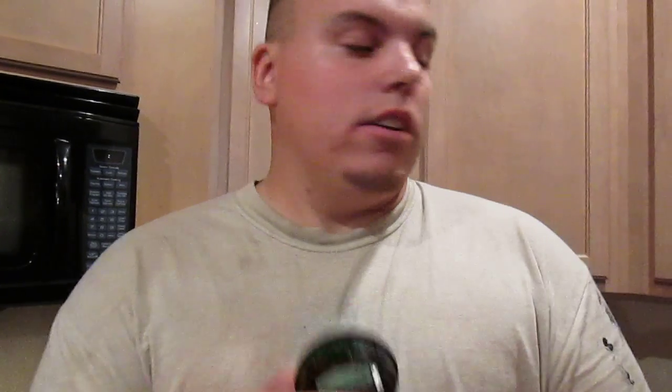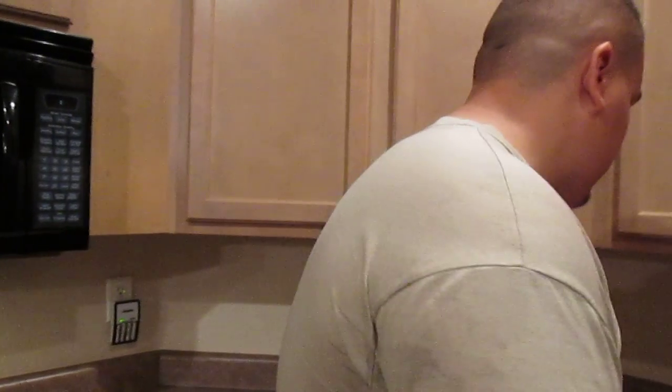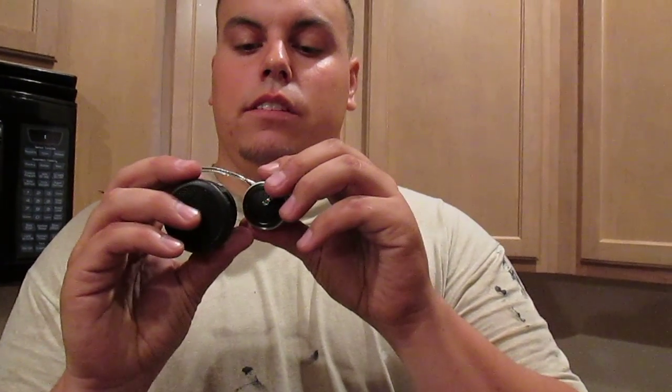So what I do is, they already have RTV in them around the edges right here and right here. They use like little RTV. So I cut the RTV, pull it out, then I stuff this inside, there's another black mounting housing that makes this wider, and then it fits in there almost perfect. Then I go ahead and I've been using a hot glue gun. Works pretty good, just all the way around to hold this in place, so I don't have to figure out something crazy. The good thing about the glue gun is that if I have to take these out or replace them, it's not in there like if you JB weld these, you're never getting them out. So I would suggest something removable.